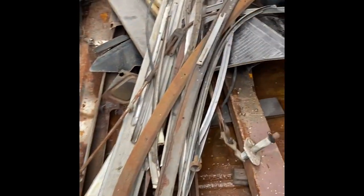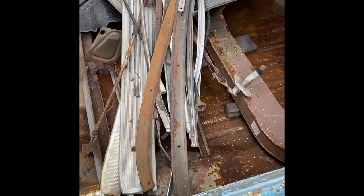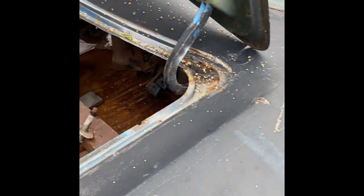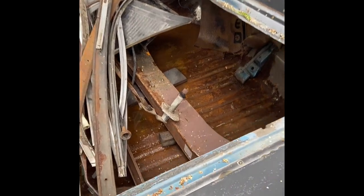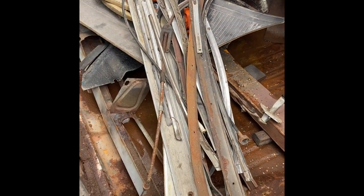This is the day after a rainstorm. I did not cover this car on purpose just to kind of see how bad it would be and show you guys. You can see there's a good three to four inches of water hanging out on the bottom of this trunk floor right now. We'll pull this stuff out, get that dried up, and I'll get a cover on top to keep more water from getting in. That's why brand new metal like this has rusted out in little to no time — always protect your cars and cover them, even as a project. Since this floor is likely coming out anyway and is supposed to have drain plug holes, let's just drill them out. I can always weld this up down the line when I actually redo it. And there you have it — drain plug-o-matic.